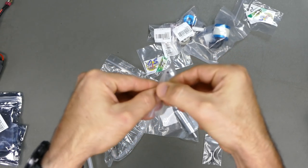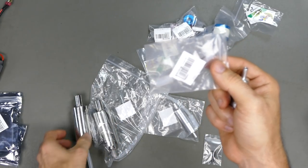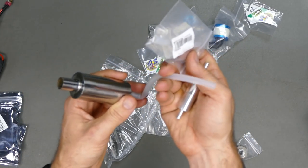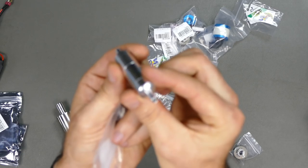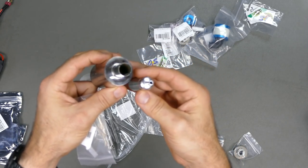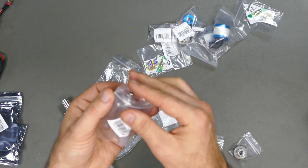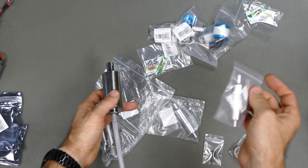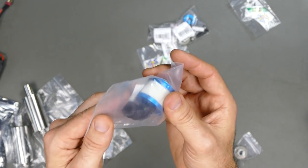I have two of these because I'm not sure which setup I'll run. These are exhaust tips and they look pretty cool. With these you don't need to run copper pipe — you can just run plastic tubing from the manifold straight to the exhaust, making it much easier to route to the back of the car. There are also smaller pea-shooter exhausts, though the larger ones may not be to scale depending on your build. On my crawler I just ran straight brass tubing. You also need an air filter — you don't want debris getting into the motor. I'm guilty of running them without air filters when they fall off, but I'm more conscious of that going forward.